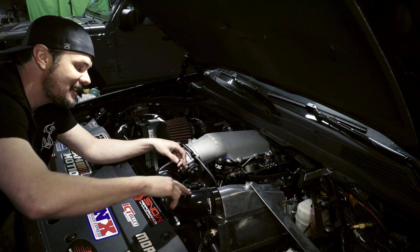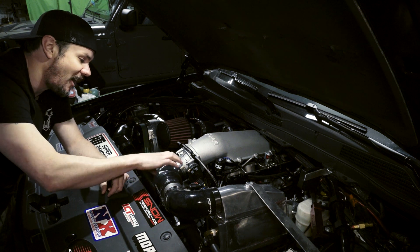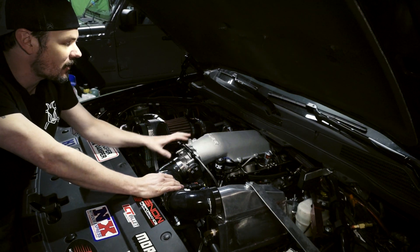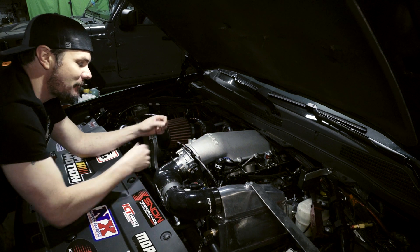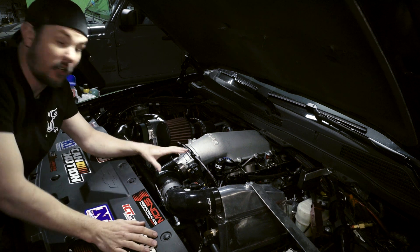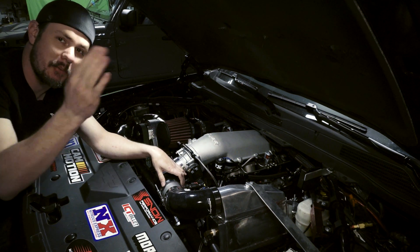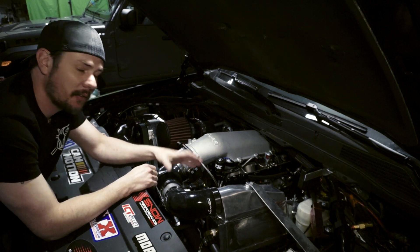What's happening is because of the 90-degree bend, we're getting airflow — especially at low RPMs — that is not really engulfing the mass airflow sensor very well, so it cannot consistently read. On top of that, with a healthy cam and being this close to the throttle body, we are getting some reversion in the intake track. With the overlap we're seeing on the cam, there are pulsations in the air being drawn in, and every once in a while this thing is basically reading no airflow. If you look at the frequency at idle, it jumps a lot — you're not in steady state. Mass airflow sensors are designed to measure airflow in steady state.